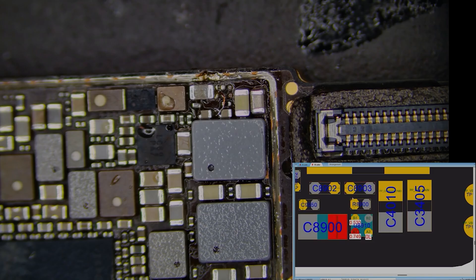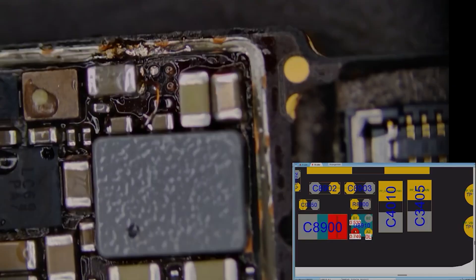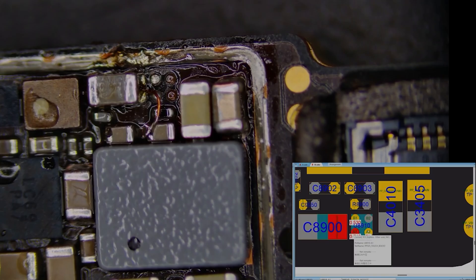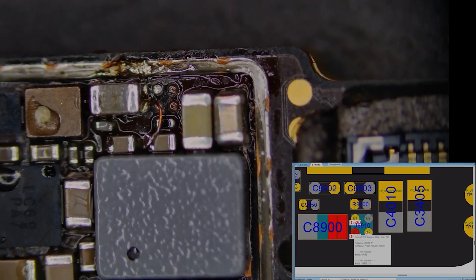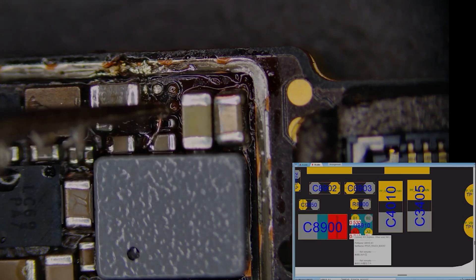They forcibly applied a 5.5V input to a capacitor on the output side of that rail. By doing this, you're basically stealing power from your neighbor. It'll work, so we really don't have to mess with this if it's actually supplying the right voltage, but it isn't optimal. Basically, what they're doing is bypassing a rail and providing 5.5 volts from another rail to it. Let's not focus on that for now.